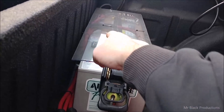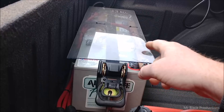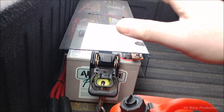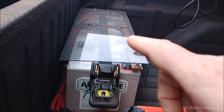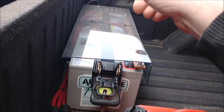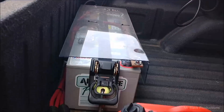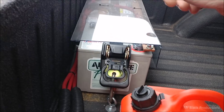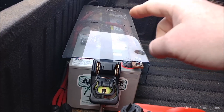On the output side, our negative rail goes over there and our two positive leads go over there. Remember, in this particular setup, because we're consuming roughly 500 to 600 amps worth of current, we're using the batteries and the supercapacitor to support our voltage as our storage devices. So we're going to have a larger run of cable going out to our consumption point, which is our amplifiers. We have another secondary ground wire that goes off to the frame on that side.